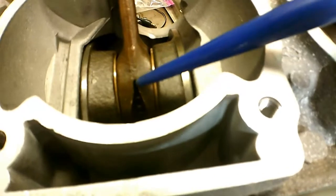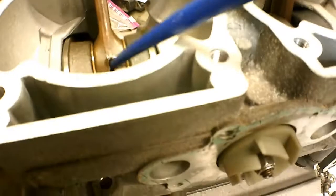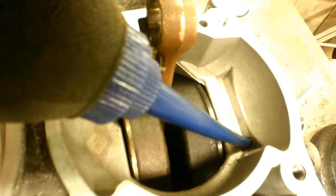Before I mount these pistons, I'm going to take and put a little bit of two-stroke oil down in that slot for the connecting rods. I don't understand why they have the slot facing that direction — it seems to me it should be the other way around, where the oil comes spraying in the engine. And I also put some down in this little hole here, which is going to go down to that outer bearing and put plenty of oil in there.